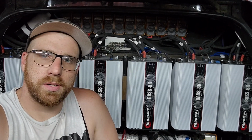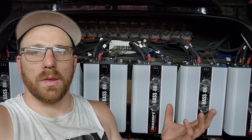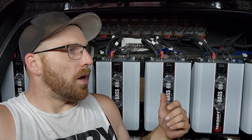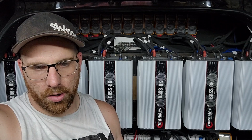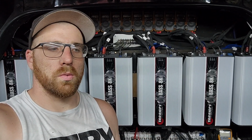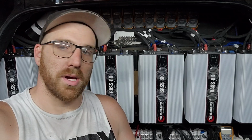We're going to just play around with that a little bit. I'm not expecting a whole bunch of gains on burps as of now, but we'll see. And then park and pound, all the way out on the knob, full knob, all out on the head unit was 105.6, and the most I've turned it is 3/4, which was about 68 to 70 volts. So I mean, pretty big gain there.